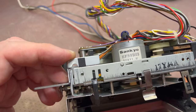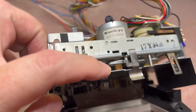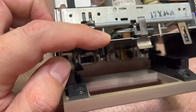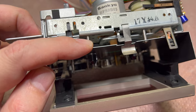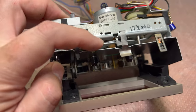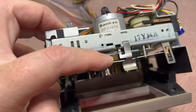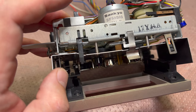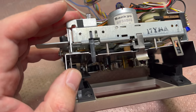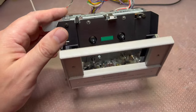There are just two belts in this tape transport, and we also need to replace the idler — you can see this one has an idler. I'll need to order everything. More modern versions of this tape transport have gears here for the reels. I believe my Nakamichi DR2 has gears because I didn't replace the idler — it's an older version.